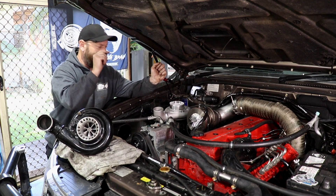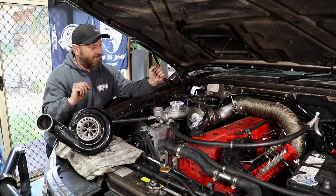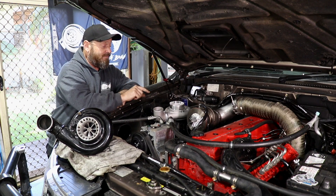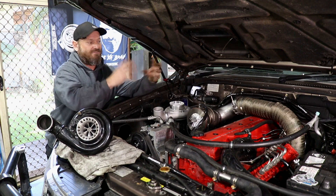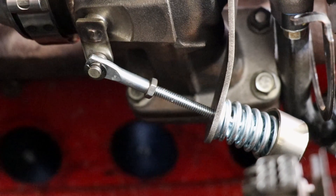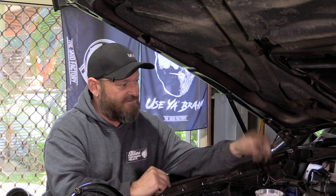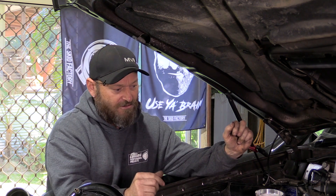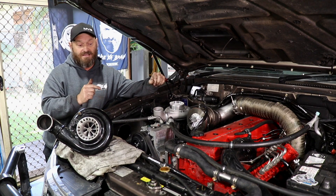So what we're trying to do is put a turbo on that's going to come on boost fast. This is supposed to be the duck's guts. I got it from Matt at Double Duty Diesel in Sydney — super helpful guy. Another thing about this turbo is it doesn't have a wastegate. It's basically a free float, so it just makes whatever boost the engine can allow. As a system it does however have a spring assembly on a wastegate valve that's there for exhaust manifold pressure relief if it were to get high enough. Most of it's on there, just got to do a couple more fab things, whack the compressor cover on, join some things up.